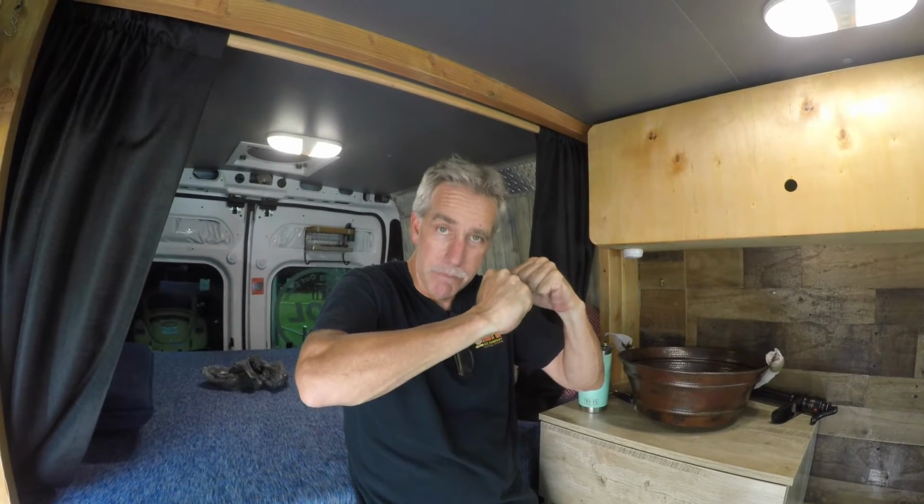These trucks are built to carry heavy loads, but you're going to feel the load back there with the factory installs. So when you have the Timbrens on there and you put that heavy load in the back, the truck comes down less and those Timbrens make contact, so the truck doesn't have room to do that. It'll ride more solid. You will have some sway. It doesn't eliminate it, but it improves it vastly, and it makes it just safer.